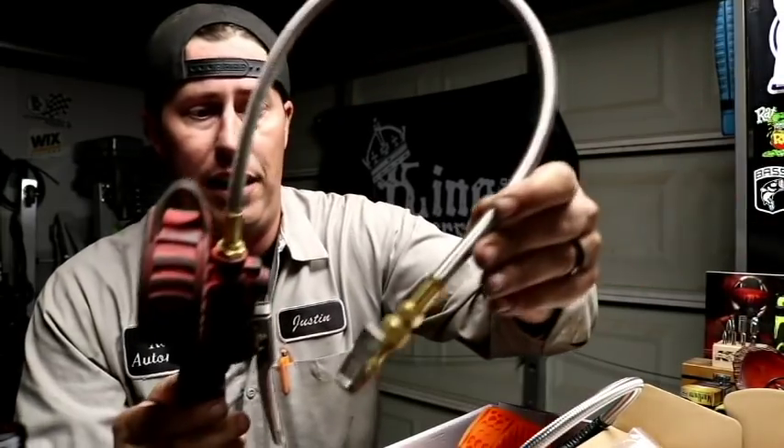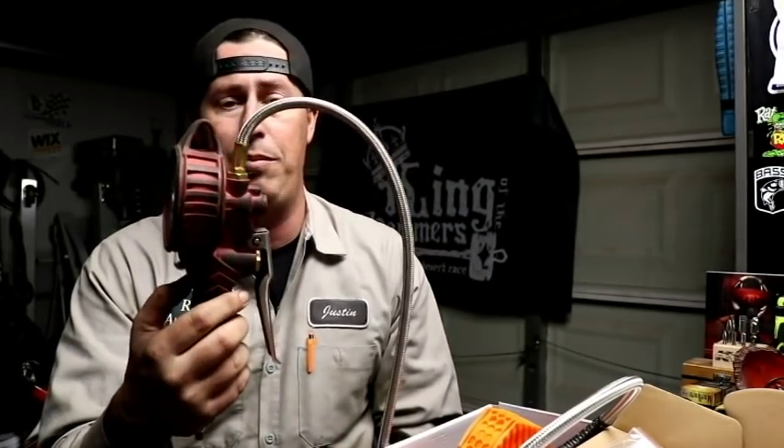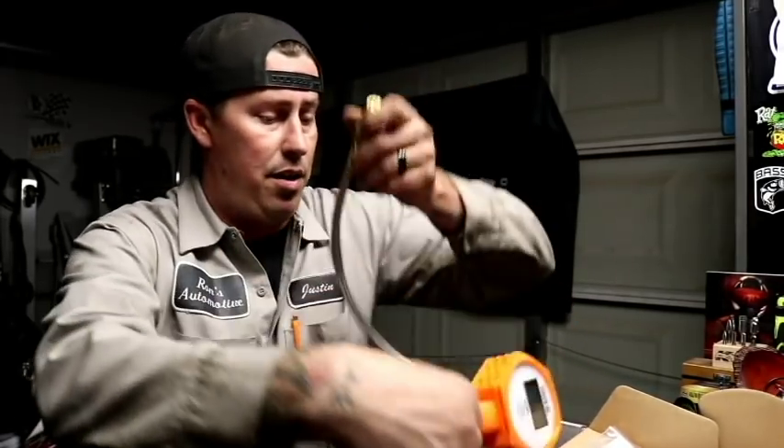The first one I picked up — I had to buy the aftermarket braided line after the rubber hose gave out. What happens is it gets hung on stuff, dragged around, flipped around, and the rubber starts to split — next thing you know, air comes out. That rubber line didn't last any longer than maybe 12 months before I was changing it out for a braided line. I'll try to find a link to the braided line and the Astro tool in the description. I'm taking my old school one to work so it can continue to get used and abused, and I'm going to leave my brand new orange one here at the house for topping off the air in my KTM and our vehicles. That was my Monday pickup.